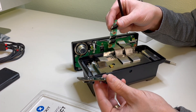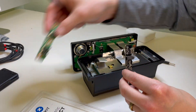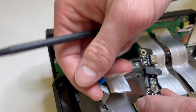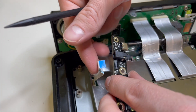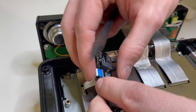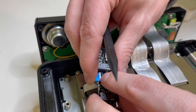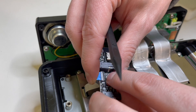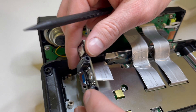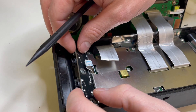That's really all it is — you just take your original board out and put your new board in. I'll go ahead and reinstall it so you can see how that works. Slot it in like this, apply hardly any pressure at all — these are fragile connectors — just push them in, push the clip down, and fold it back into the housing.